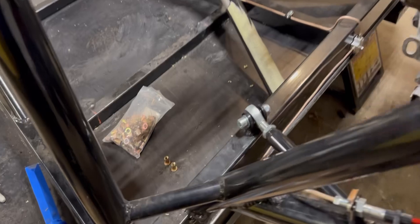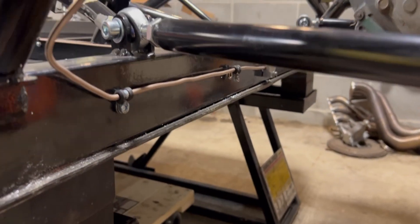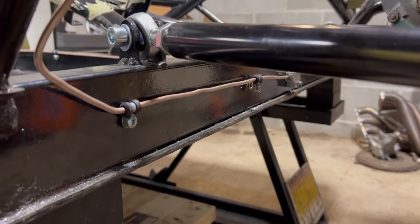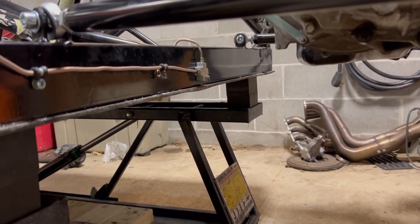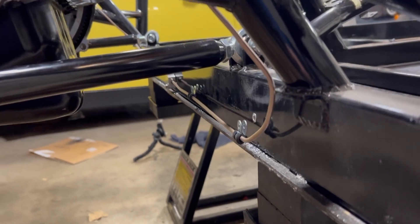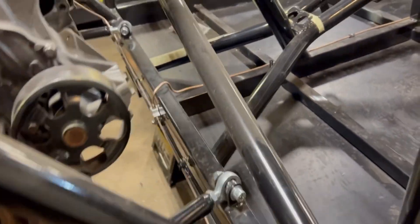I need to drill some holes for the P-clips and put some nutserts in. I did kind of screw up here because I put metric 6 nutserts in and totally forgot that the ones I did on the other side were metric 5 — so I ended up having to drill the P-clips out. This side is going to have metric 6, the other side I'll do metric 5 since it makes no sense to drill those out. I'll have to get some M5 screws for the other side — but let's build the other line and worry about that later. Got that one all done — I did remember to put the M5 nutserts in this time.